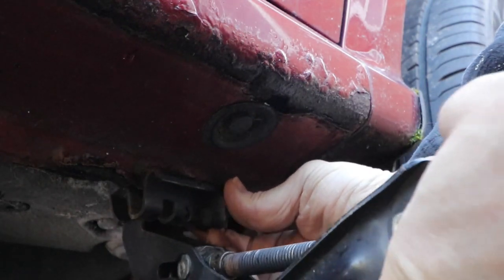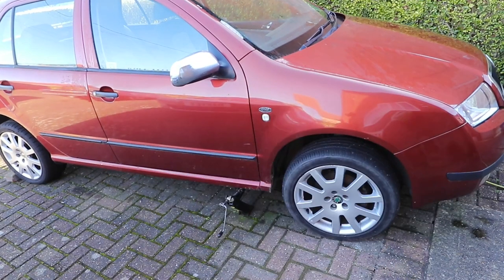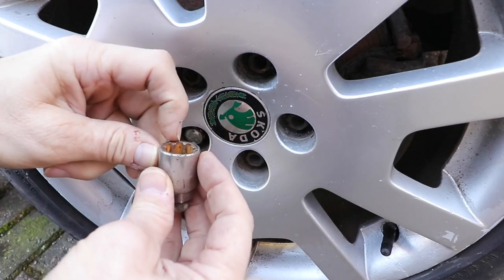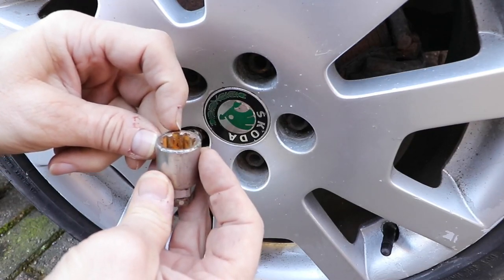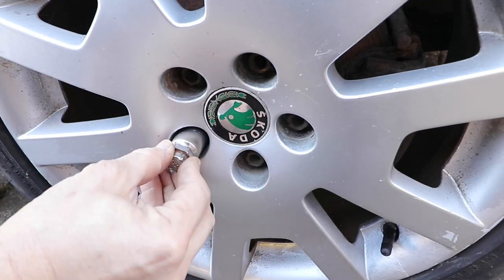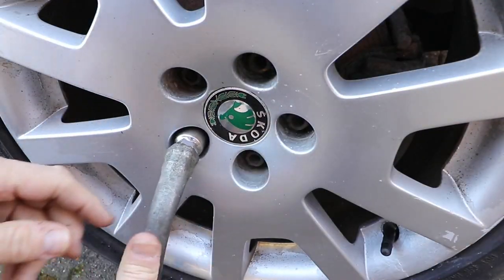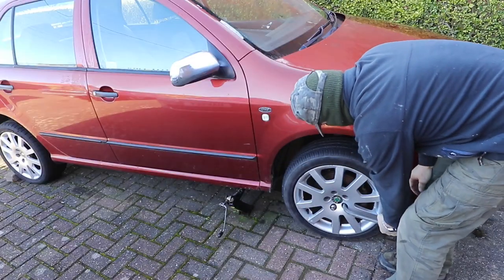Mine's a little bit rusty, which I'll have to sort out some time — and here's the main reason why it's not on the road at the moment. Once you've got the jack in place, you want to be loosening all the wheel nuts off. I usually start with the locking wheel nut, which has always got a special adapter that you should find in your spare wheel well. Mine's got little serrated combs inside that are different widths, which correspond to the bolt. You just move it round until it slots on. Loosen the bolt — not take it off — and do that with all the other ones.